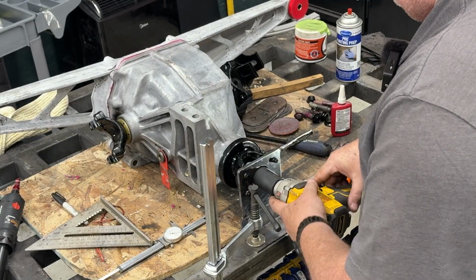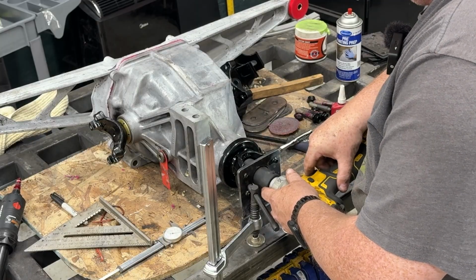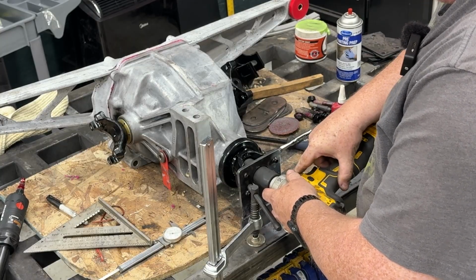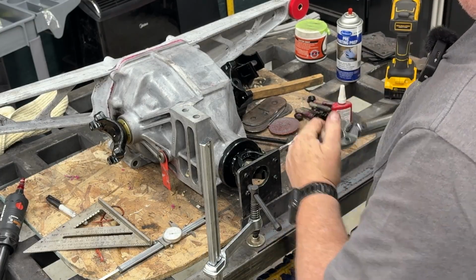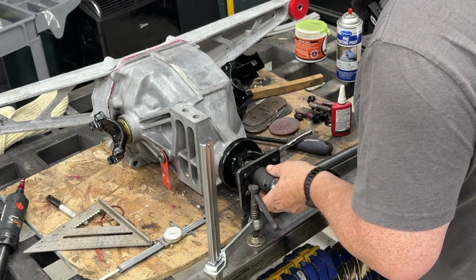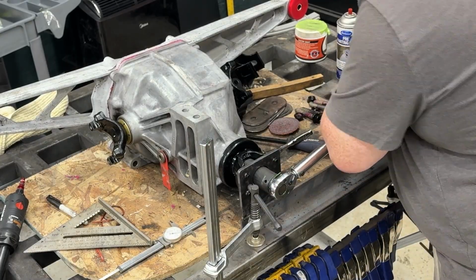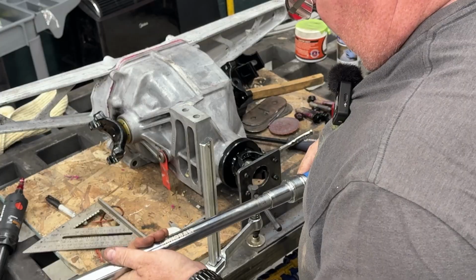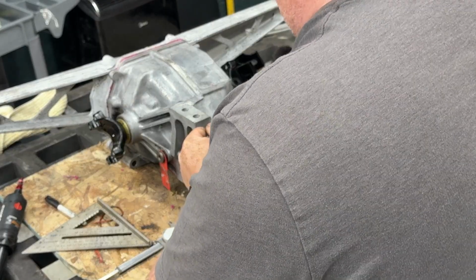So I'm just going to suck this in to start with the impact slowly. Okay, I got a few wagga waggas on it. Now, put this on. I've got my wrench set to 200. There's only one bolt, might as well go for it. Oh yeah, that's gonna be a lot. There it is, set. Okay, it's 200 foot-pounds. That's a lot. Okay, so I'm gonna label this tool and put it on the shelf, because it is handy to have for the next one I do.